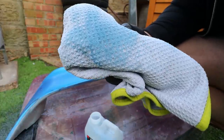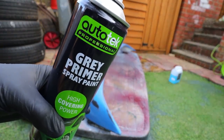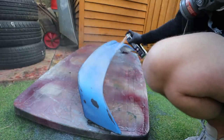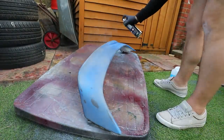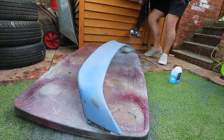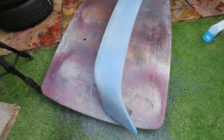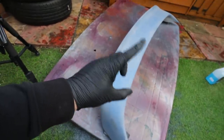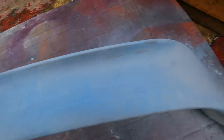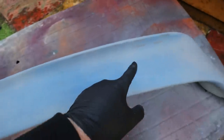You can see all that the wipe-down has taken off — it turns up blue. This is the primer I use — I buy this off eBay, Autotech. Right, there we go — the first coat. That first coat is just to allow the rest of the coats to adhere — it just needs to be really light, just a quick dusting over. You can still see plenty of the blue through there, but it seems to be good. I think a few of these scratches may cause me issues — some of them are still quite deep, but we'll see how we go.